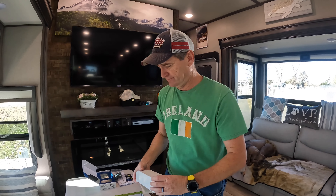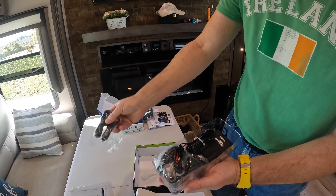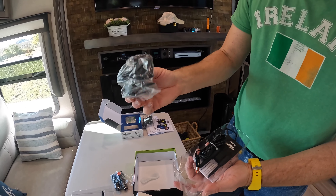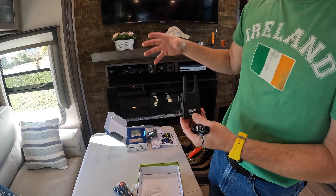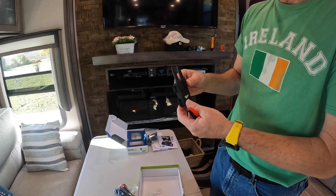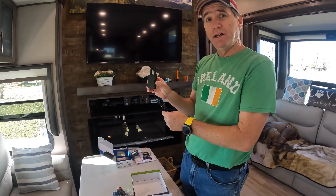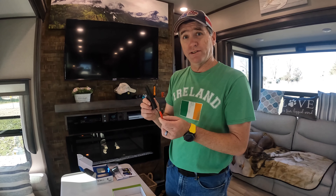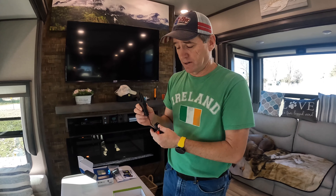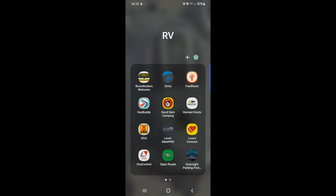I almost forgot the little white box at the bottom. This will have our transponder, our booster, and it should have the mount with the suction cup. Sure enough — we've got a couple of zip ties, our power cord if we want to use that with a USB adapter, our suction mount, and this is our booster along with instructions for it. They say to put it as close to the front as possible, possibly on the outside, so I'm going to put it in my wet bay for now, then hard mount it inside my pin box of my fifth wheel. They give you alligator clips, but I'll terminate these with ring terminals so I can have a secure mount up to my bus bar.